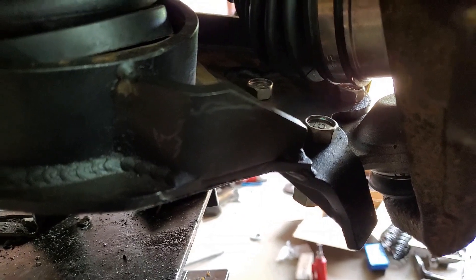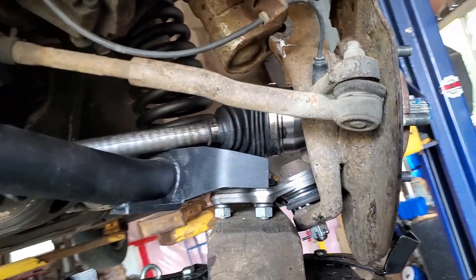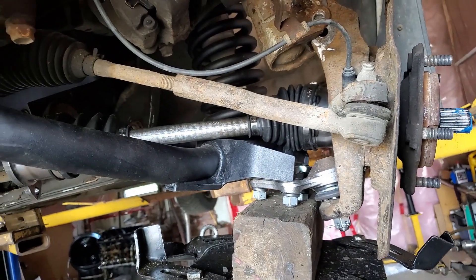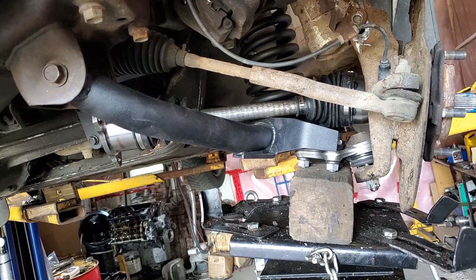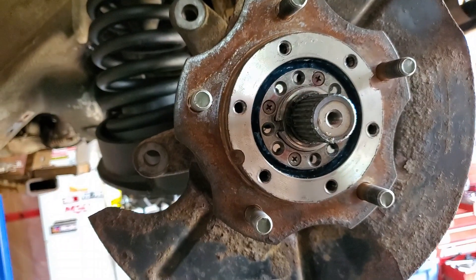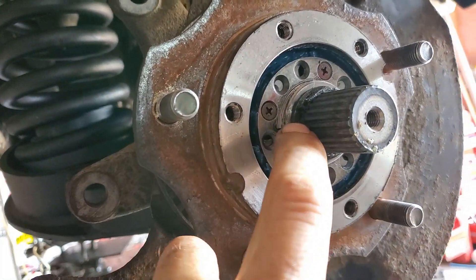When putting the driver's side together, don't forget to put your axle in first, because once it's bolted up you're not going to get it in. It's just how Suzuki set this up - it's a bit of a pain because when this axle needs to be changed at some point it is going to be difficult with that spring. Also, before you put your locking hubs on, don't forget to put your spacer ring and snap ring back on.